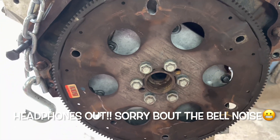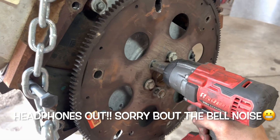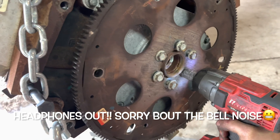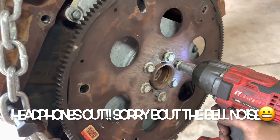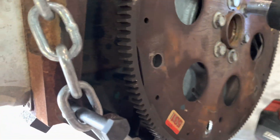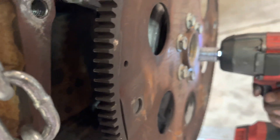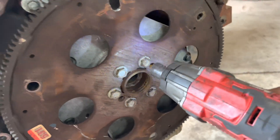They are all started. Don't rely on me for torque specs because I have no idea what they are. If you're a torque-spec-only kind of guy, don't do this. You're just gonna snug them up like a tire using the star pattern. Once you get them all, go back around in a circle.